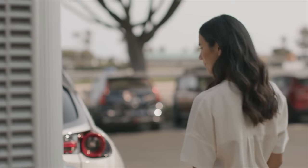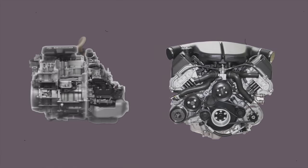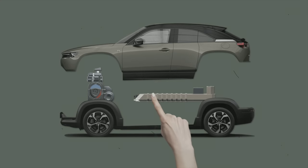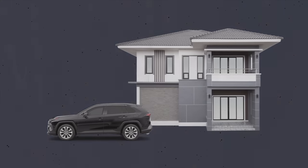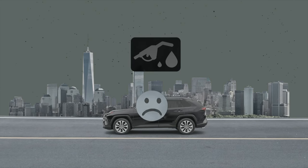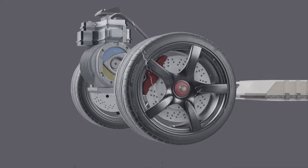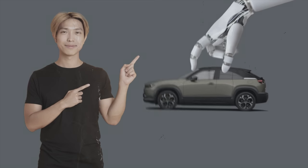That's not to say rotary engines stink — there are real advantages to using a rotary as a range extender. First is size: rotary engines are smaller than piston engines, so you don't need to design the car around the engine — you can optimize the EV's primary parts first, then decide where to place the rotary. This also improves the car's interior and cabin space. Rotary engines are also light — most plug-in hybrid owners charge at night and lug around a heavy piston engine dragging down fuel efficiency, but a small light rotary extender minimizes that waste. And because the rotary doesn't reciprocate, you don't get engine vibration and noise like piston engines — it's quieter and delivers smoother power.